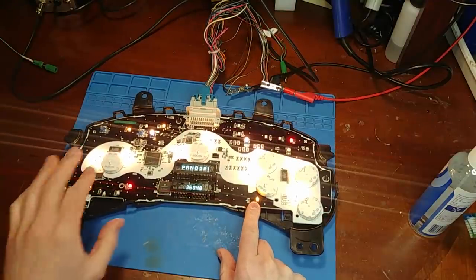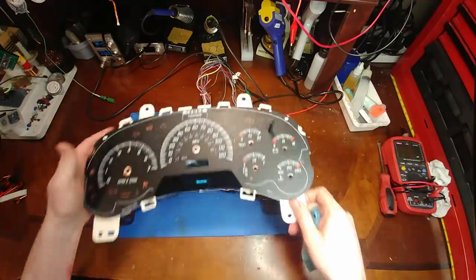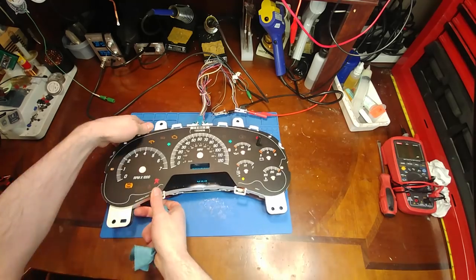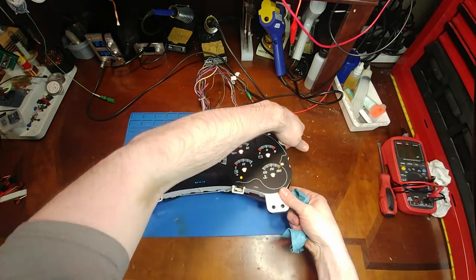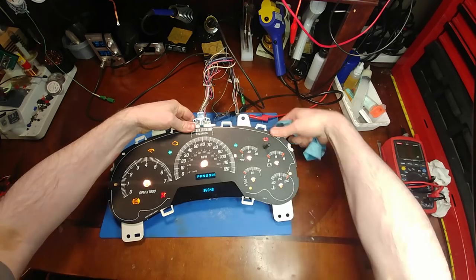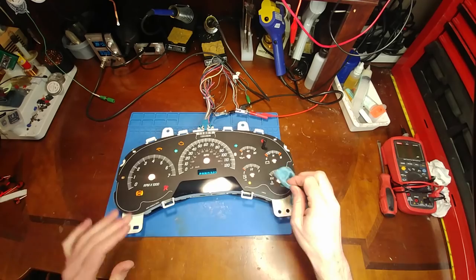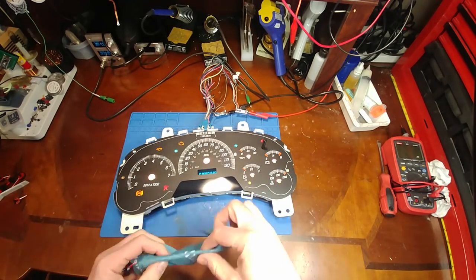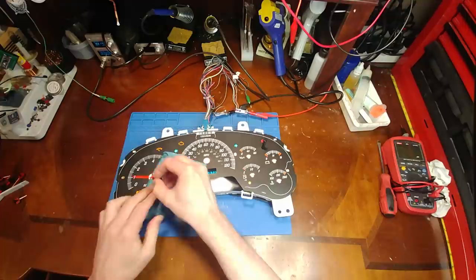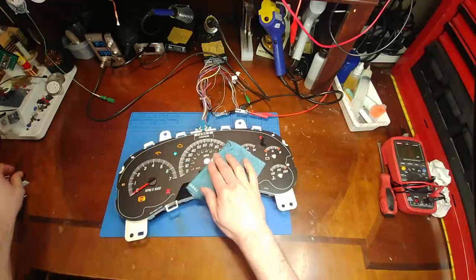With the new motors it's a little bit smoother and quieter. At this point I'm going to let this run for a little while, just give the lamps some burn-in time to make sure we're not going to end up with a dud. Now for reseating the needles — not only is the position of the needle important so the calibration is correct, but the height that you set the needles is also important. If the needles push down too hard you'll end up with the needle dragging on the face, and if it's up too high you'll get some light leakage from the lamps and possibly the needle could just fall right off if it's jarred hard enough.